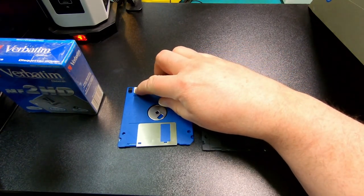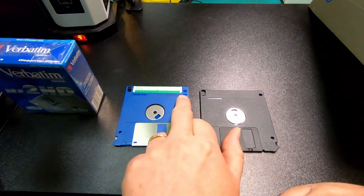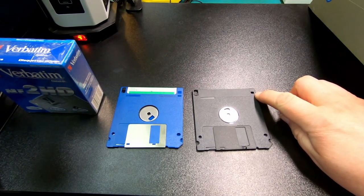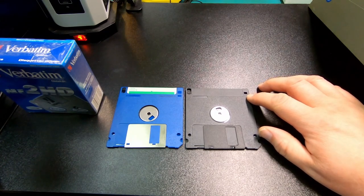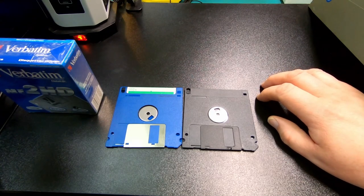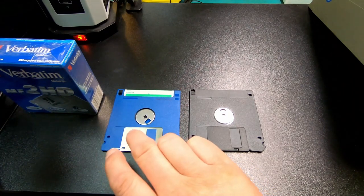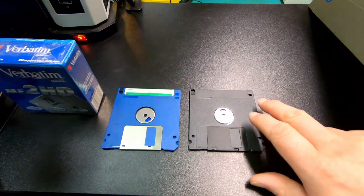You have the write protection enabled or disabled — this is a physical thing to prevent writing to the disk, on this side. And then on this side it's indicative of the kind of capacity type that it has. This is the hole that indicates that it's a high-capacity disk. It's how densely it writes the data on the disk. Documentation isn't that clear, and in some cases there are even operating systems that ignore the existence of that hole. These are not the original disks that HP used, but the disks that came with the device. This is a low-capacity disk and this is a high-capacity disk.